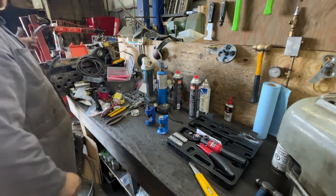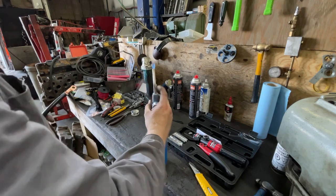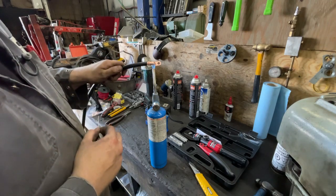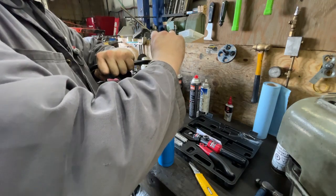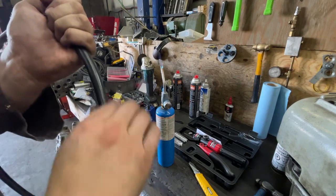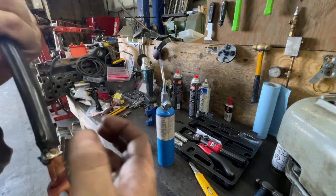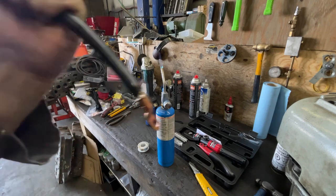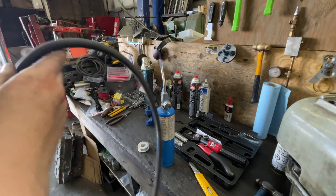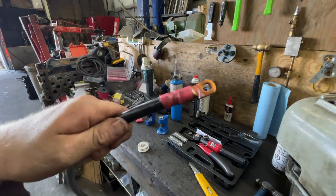Next step for me is to take a propane torch — there are lots of ways to heat this but I just use a propane torch — and solder. We're going to heat it up and make sure you get it all the way around. You will distort it a little bit with the heat; you can just press it down so you don't get a big bump. It depends on the wire — some wires have more heat resistance. This is actually welding cable and it's a lot better for doing this.